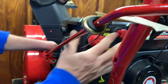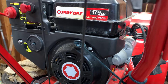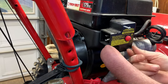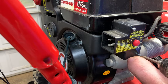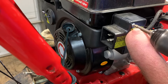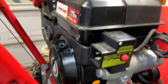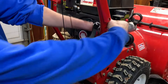At this point we have the front cover on and everything connected here. Our throttle is right here. We're going to go around to this side where this is flapping around. You take the starter button off to get this flap off, and I also put the recoil out of the way so I can get it back together again. The hard part is lining up the bottom one — once you get the bottom one lined up, the top one will line up pretty easily. Be careful — do not over-torque these, you can break the plastic. It's probably better to use a manual driver. I've done this enough that I don't break them, but I've seen people break them — I've broken one myself.